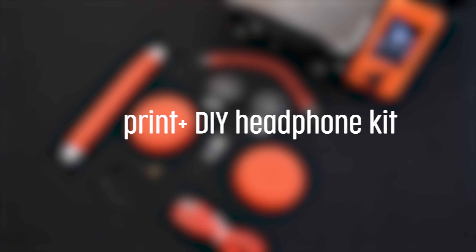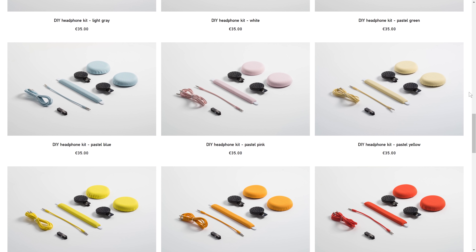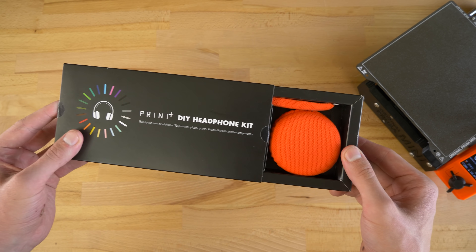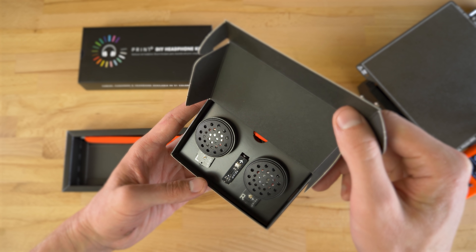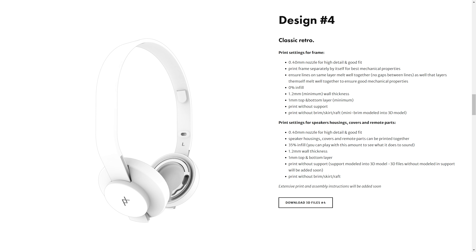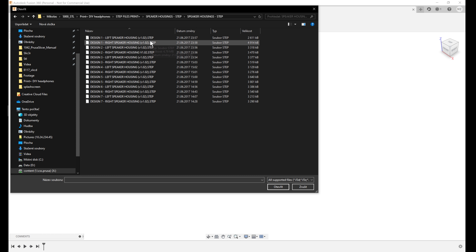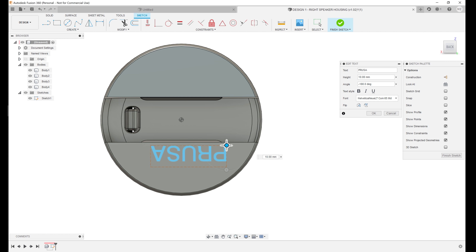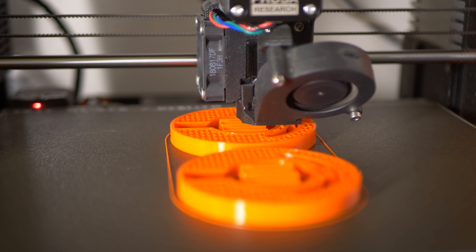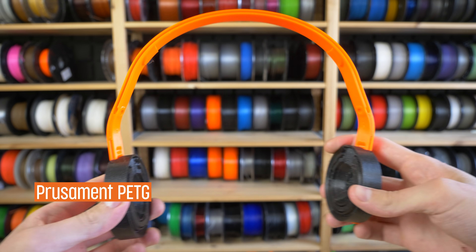Let's talk about the other company that fully utilizes the user's ability to 3D print some of the parts. Print Plus offers a do-it-yourself headphone kit for $35. What you get is a compact box that probably fits in your mailbox. It includes all the electronics — most importantly the speakers — plus the cushions and the headband. The rest you'll have to 3D print. There are seven different designs to choose from, but we thought it would be cool to modify them. We opened the provided STEP file in Fusion 360, debossed a Prusa logo on one side and an HTML joke on the other, exported the STLs, and printed them. We tried both PLA and PETG, but because both the speaker housings and the frame benefit from a bit of flexibility, PETG is definitely the winner.